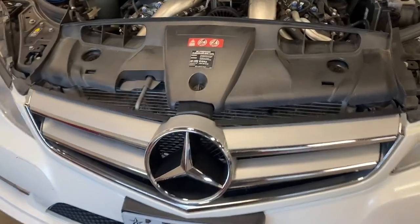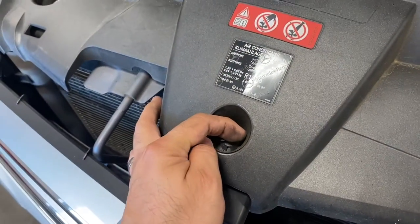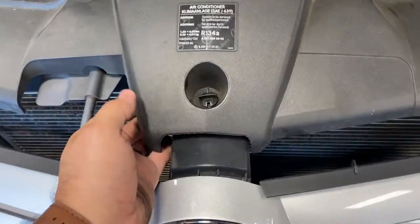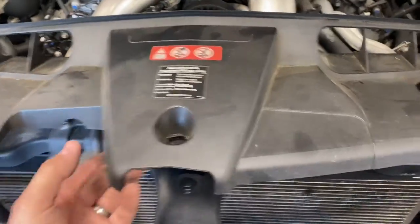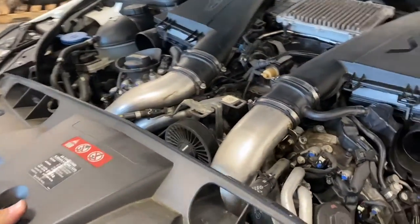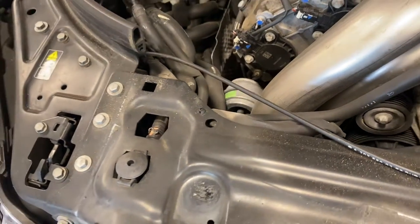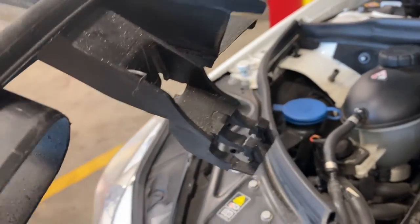Part of the process for removing the actual upper shroud is very simple. There's going to be a tab here — all you have to do is spin the tab, and it's going to allow you to actually lift the shroud up. As you do that, you're going to push the shroud toward the vehicle and then pull the shroud out. You will have this line that I'm assuming controls the opening motion of the actual hood — that's just going to clip onto this little piece right there. You just have to remove it by hand.